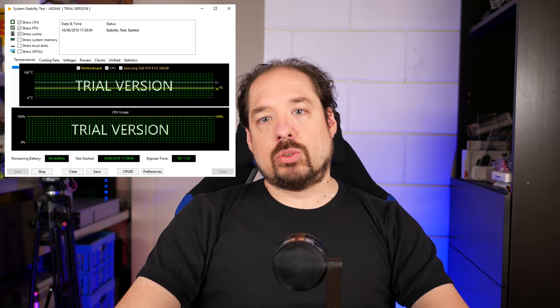Talking about fans, keeping this Threadripper cool was actually quite a big challenge. I kept running into the Noctua heatsink not being able to keep up after a while during stress tests. So I added another fan on the heatsink, and the hardware to do that, except for the fan, is included with the heatsink, so that was easy. And I lowered the voltage going to the Threadripper with a minus offset of 0.075 volts. That made sure the temperature stayed in check, even during a temperature test of like 5 or 6 hours, or a Prime95 test, or a Vegas rendering test, etc.